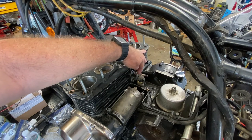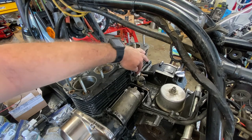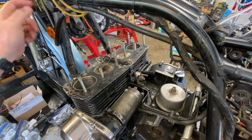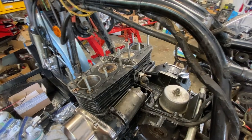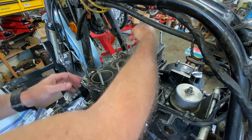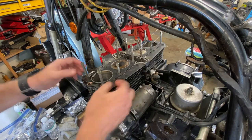So this is why we have the taps on this for the discharge and return. I don't remember, I think this is the discharge. Yeah, this will be your pressure discharge, going into the oil cooler. This would be a return going directly into the cylinder block, or the crankcase. Ugh, I can't talk today. Okay, just a side note. We're just going to leave that chain laying down in there right now. It doesn't really matter.